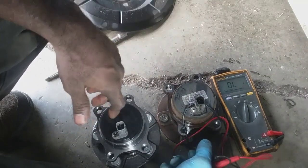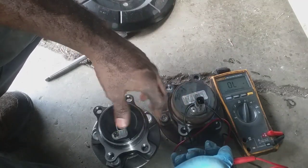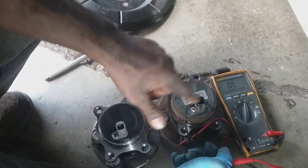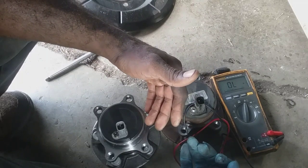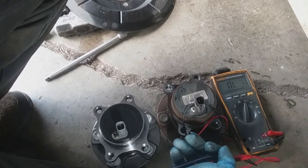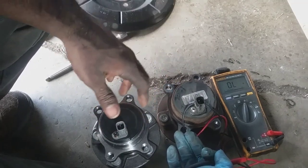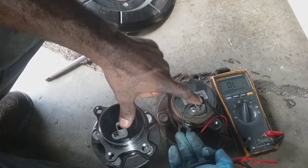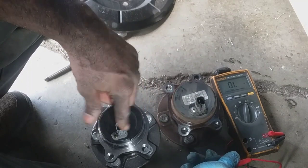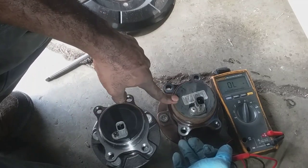So the only difference is these two sensors. Just from my conjecture, if you put one in over the other — this is why I'm going to swap those sensors. I'm pretty sure since resistance slows voltage down like an impedance, the signal interpretation going to the computer is going to be different. I wouldn't mind seeing what happens if I leave it, but I'm pressed for time. I'm going to swap these out — this part is $30 cheaper than just the regular ABS.